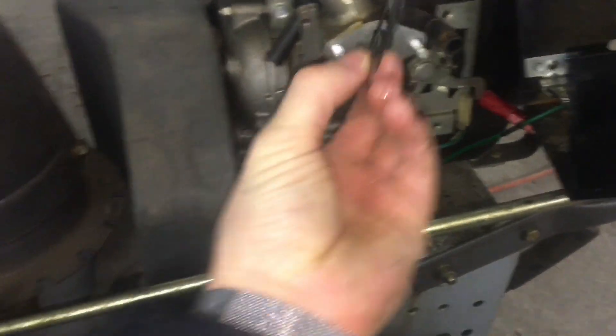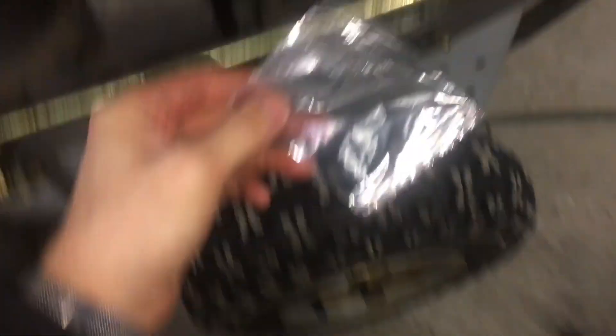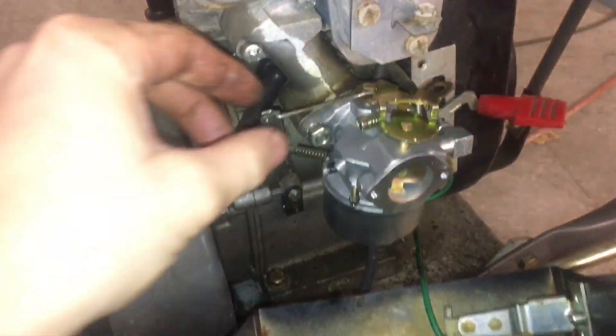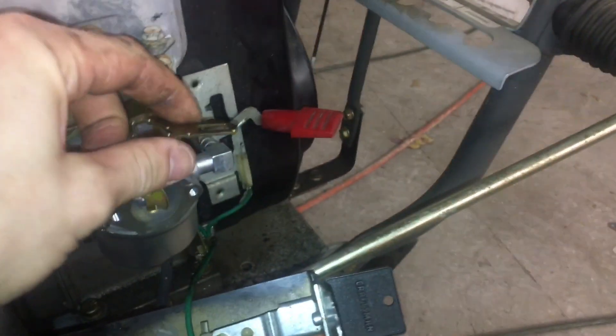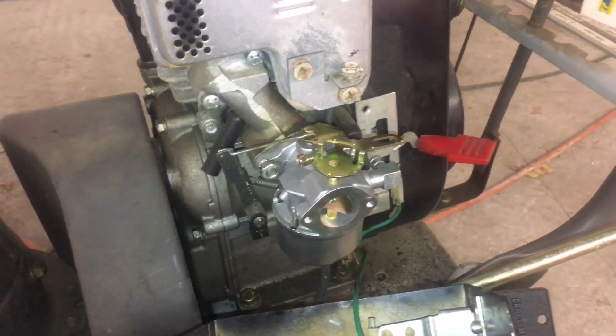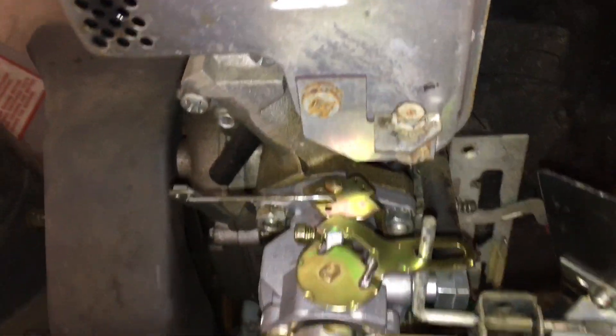You could almost certainly transfer the bowl over to your China carb, but I'm not going to do that. The old gasket I took off actually looks really good still, but since the carb came with a new one I'm going to use it. These are not captured hardware, so be a little careful when threading them back on. Next step: put the gasket on, seat the carb, tighten down the two little nuts, then get the brackets and linkages back on. There's the shiny new carb with all linkages reattached — now put the choke lever back on and reconnect the fuel line, and it should be ready to prime and fire up.